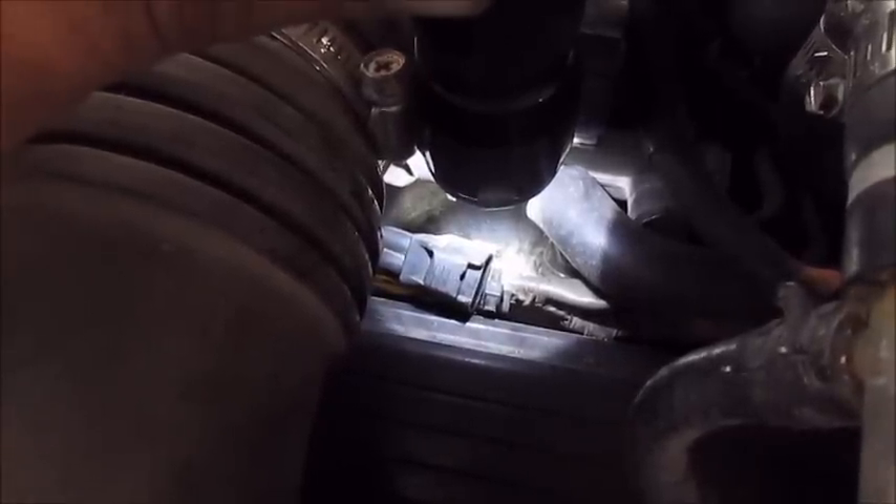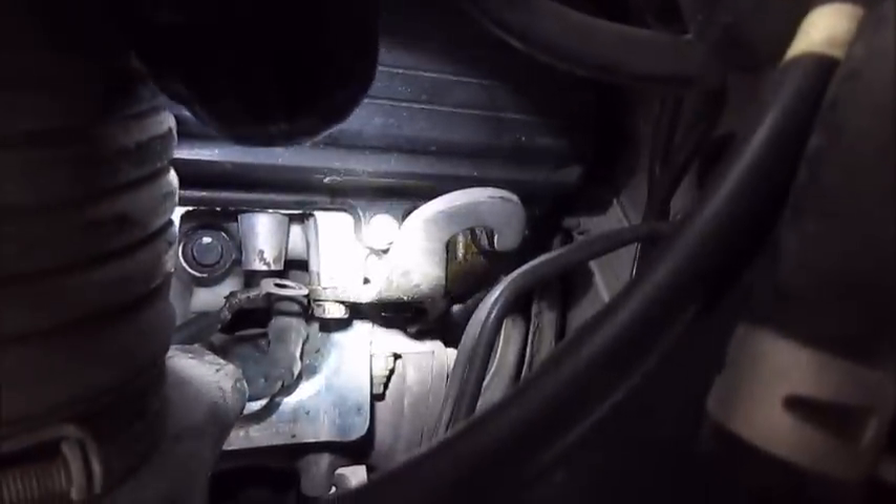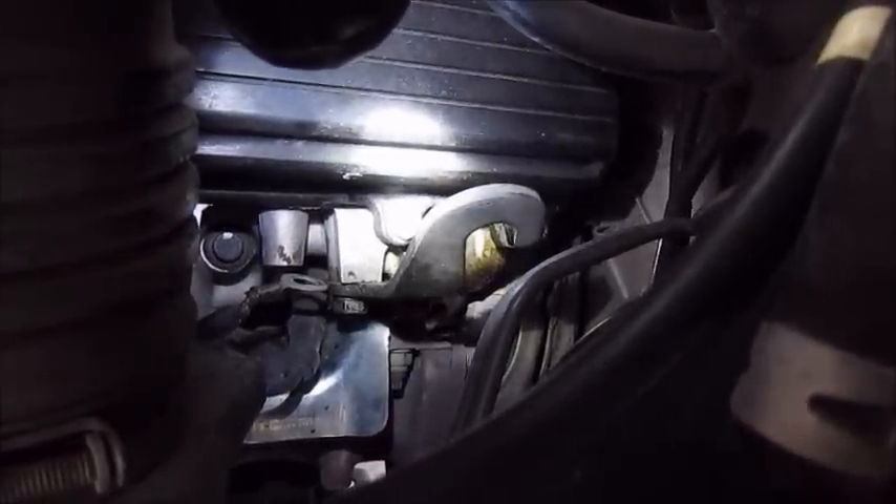He said something about the displacements of each cylinder, and he said he used a knock sensor out of a 97 S10 and said it worked. It was only 30 bucks versus the 150 to 200 wherever you find it. I mounted it — it's not on here right now — but on this lifting bracket, pulled it off, drilled a hole, tapped it, and then installed the knock sensor. I ran it and tested it first.